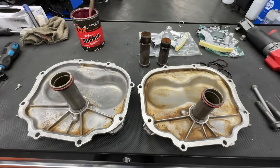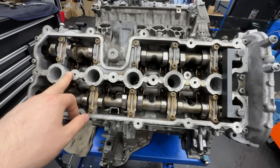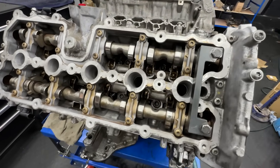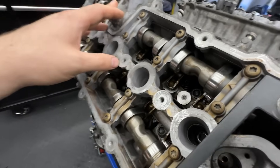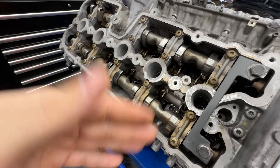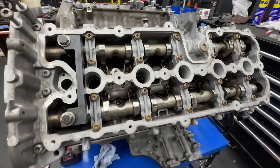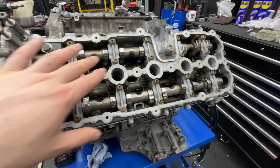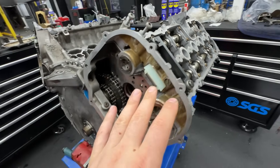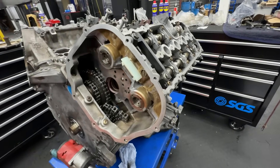So we will continue with the camshafts and everything on. I did have to clean a few spots so the camshafts are spinning nice and freely. First I tried without the rocker arms and the hydraulic lifters - they were not replaced, I don't see anything wrong with them. I checked them when stripping the car and none of them were soft or anything, so we are using the ones from the engine. We put a new gasket onto the top of the cylinder head for the carrier, and I have to finish off the whole timing chain setup, with the cylinder head tensioners installed and a new slider put in.